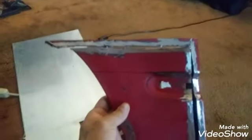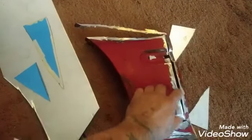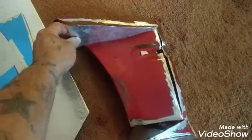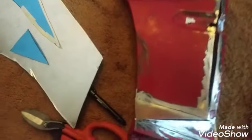As y'all see, this is the cut that I had to do in order to achieve that look. Everything of course is gonna be filled in with metal and welded. This plate goes here, it's gonna be filled in and welded. This other one is gonna be welded as well. Once this is tagged, I'm gonna hold it up in place. That's where the fiberglass cloth comes in for little gaps, and the bondo filler. Over here, I'm gonna cut some metal and fill it in.